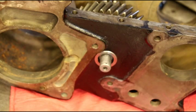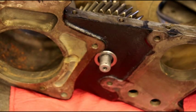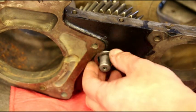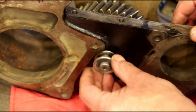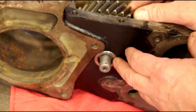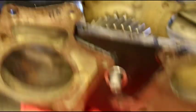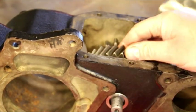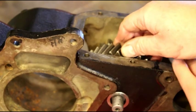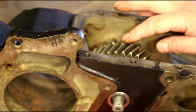You're gonna get some instructions when you get this from Advanced Adapters — they're kind of blurry, but they give you dimensions and show you the basic assembly. When you start tightening this nut and washer — they give you a washer but I don't like the way it fits, I got a different one. When you start pressing that in, that's going to give you your preload on your bearings. Just by banging that in, we took all the slop back and forth out of that, and it still spins freely.